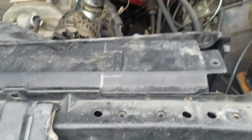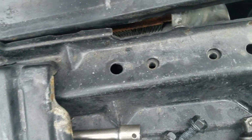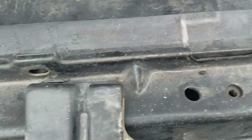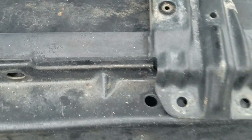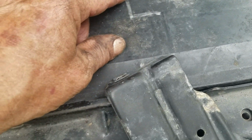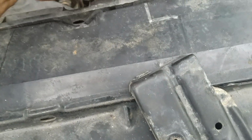We're going to modify the fan shroud. This is a diesel, remember, so it had the big old wide radiator in it. We're not running that. This is a 4-core. It's a plenty fat radiator, but we're just going to run something we can get hoses for pretty decently. So we're going to trim that bracket, shorten it up at this end, and cut the shroud off down here somewhere. Right here, I guess, and bolt it up. Got to put the fan on yet.